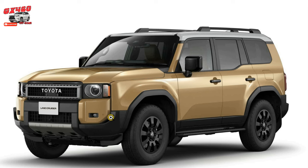This is one of the lead engineers on the Land Cruiser 250, and here we have a Land Cruiser 250 frame on the TNGAF platform. He's going to point out the differences between the Land Cruiser 300 frame and the Land Cruiser 250 frame. The first thing to realize is that the Land Cruiser 250 frame is lighter — they made the metal not as thick as the Land Cruiser 300 frame, and they shaved it back quite a bit.